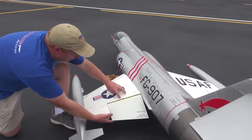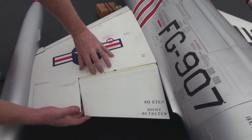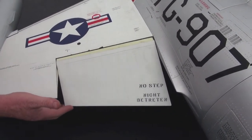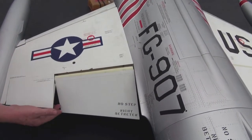You can see there's some damage to the skin. What happened was this skin got trapped and stopped the flap from going up — it actually cracked out some area here. What I did to fix that was I bent this wiper down some more and rounded the edge.